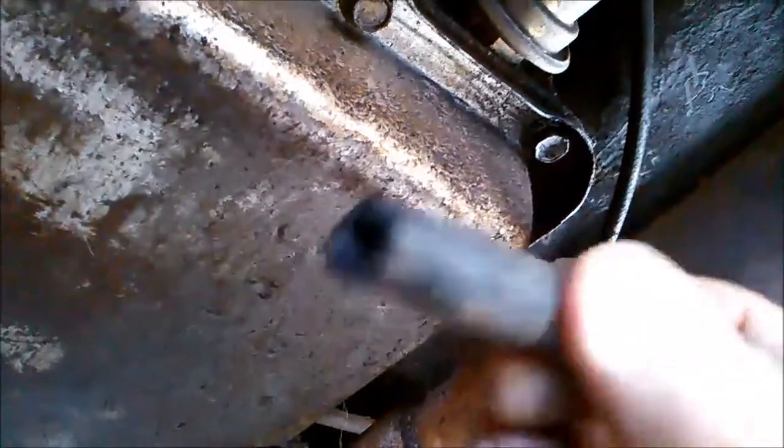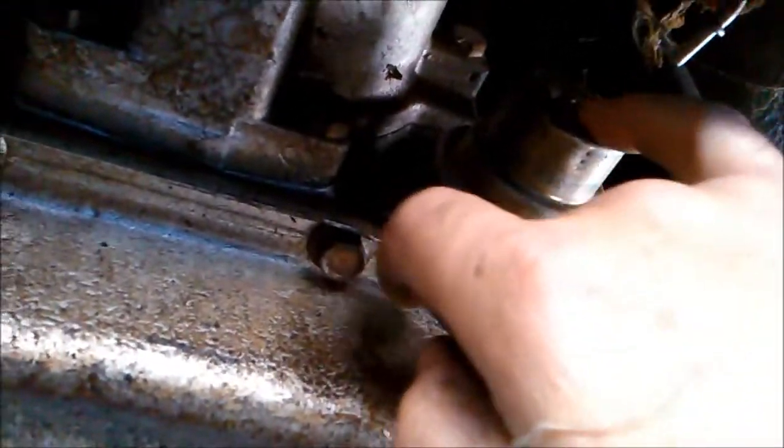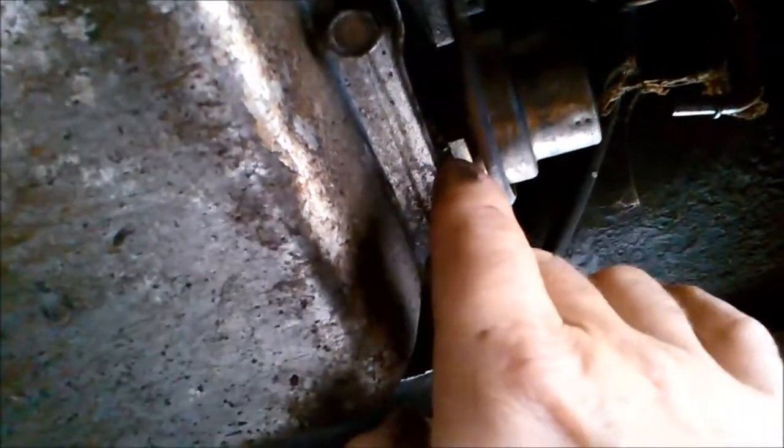The vacuum hose - you can see it was just sitting there. It's the wrong hose as well - looks like they've put a double hose on there. It's not a vacuum hose, someone's adapted it. It's also important to pop that hose off and just see if there's no fuel vapor or oil coming out of there. Fuel will sometimes dissolve the little diaphragm in the modulator.